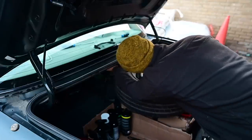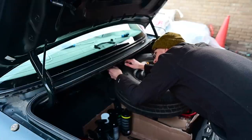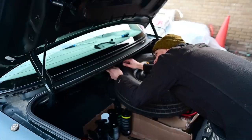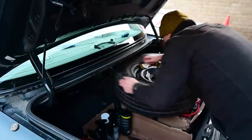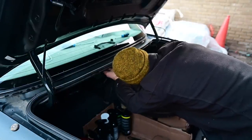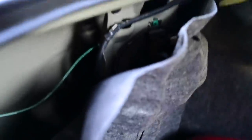It's actually quite hard to see because it's tucked underneath the parcel shelf. What I've done is stripped back the green insulation from this brake light wire, tinned it up, and I'm bringing the two together without hurting myself or setting fire to the car. That is now pushed back through the parcel shelf so it can be reconnected to the high level brake lights. The green wire is now tucked inside the structure of the car as much as possible, and it pops out down here.